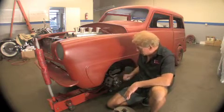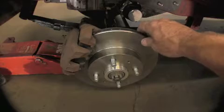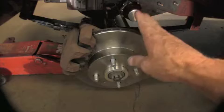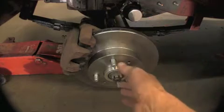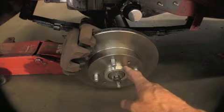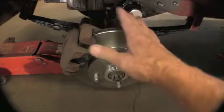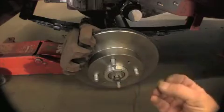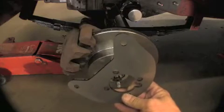Let's take a closer look at our disc brake system. Utilizing a more modern disc brake setup was good for our application since we have a 340 horse engine in our vehicle. What we've done is we actually made our bracket, we actually made our hub, which actually takes the original bearings and seal from our original Crosley drum. We incorporated our disc brakes in the forward motion to give us more stability and stopping power. Our bracket actually mounts on our original spindle.